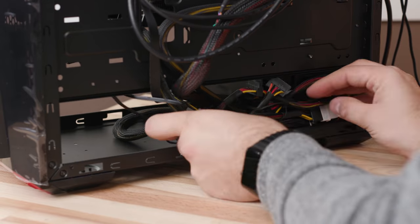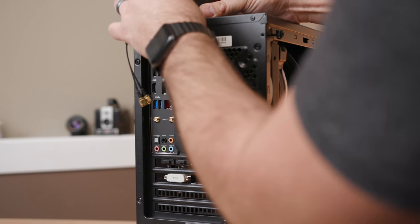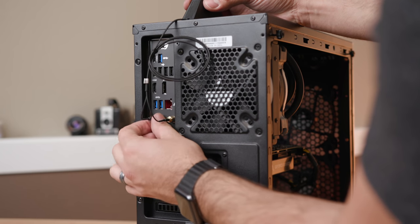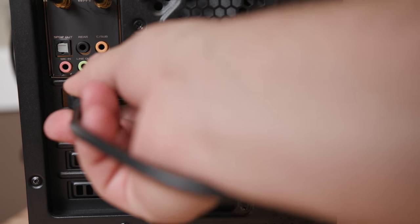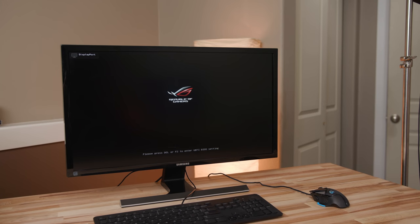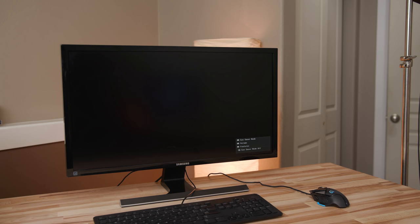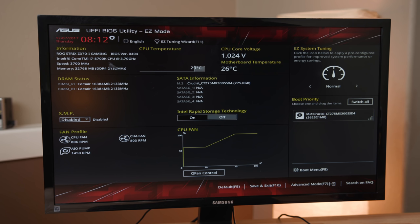Now I'm going to do a little bit of cable management, install the front cover on our case, and install our wireless antenna for the motherboard's built-in wireless card — this is for Wi-Fi and Bluetooth. Now is the moment of truth — will the PC boot up? If you did everything correctly and didn't have any faulty parts, everything should boot up just fine. Press the power button and you'll get some fan noise, and the motherboard and case fans should light up. Connect a monitor, a wired keyboard, and a mouse. Even if you don't have Windows installed you should get the motherboard's BIOS. Here we want to check the CPU temperature — we don't want it above the low 40s; we're seeing 29. Our RAM is showing up with both sticks, and we can see our all-in-one water cooling pump and the two fans plugged into the motherboard.